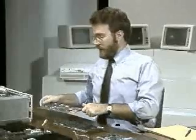We talked about 8-bit boards before. As you'd expect, 8-bit boards work in either 16-bit ISA, 8-bit ISA, or EISA slots. 16-bit ISA boards work in either 16-bit ISA slots or EISA slots. And EISA boards only work in EISA slots.